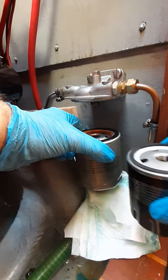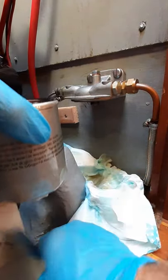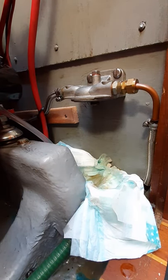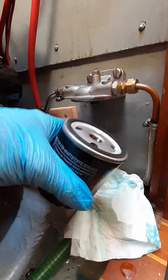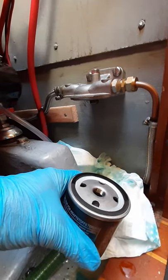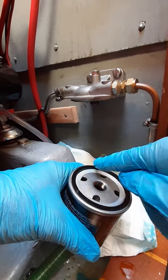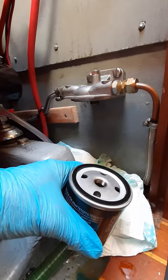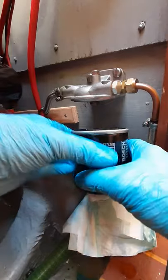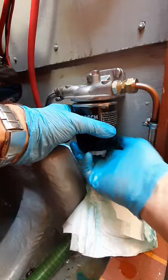To put the new one back on — I'm just going to put that down there for now. Get a bit of the fuel you've just been working with and moisten the seal, the rubber seal, so that you'll be able to undo it again easily when you get this one off. You need to do this about once a year. Then you fill it up, hold it up, spin it on again.